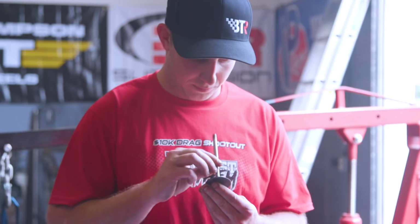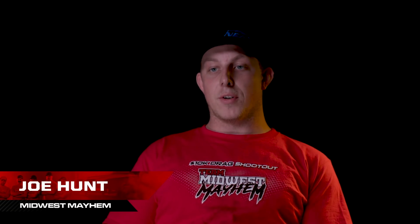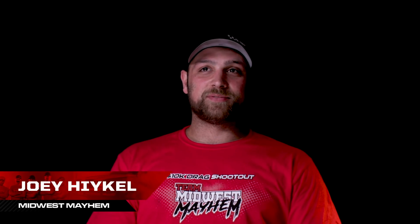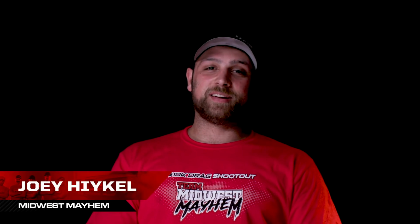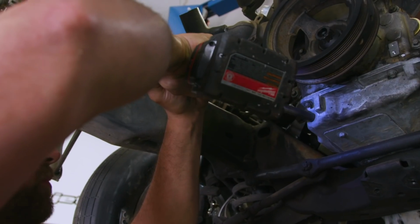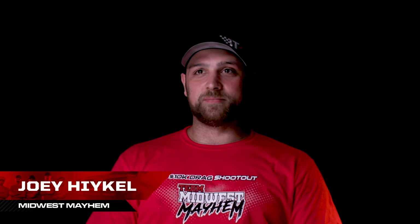We wanted to be able to stretch that out by spinning more RPM. So we spent the money in valve train to make it more efficient and get the revs up and keep the valve train stable to make more horsepower with that small turbo. There's a lot of doubt because they are scared of using stock parts. From where we come from, a stock LS with 1,000 horsepower is not unheard of. There's plenty out there. I own one. They feel like you have to do all this stuff to them to make them last, and it's not true.